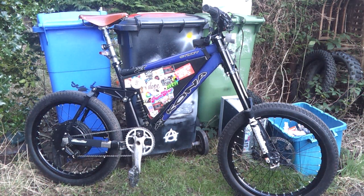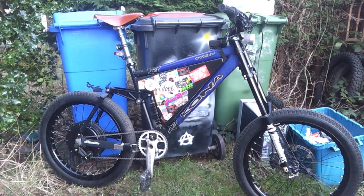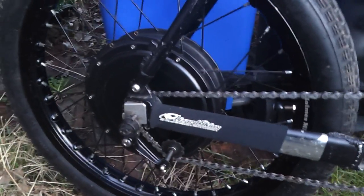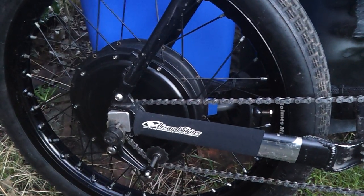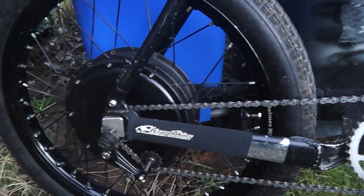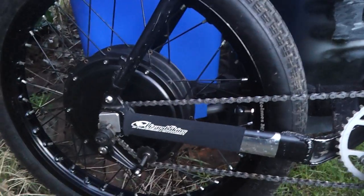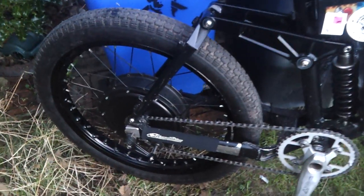So there's your hub motor in the back — it's just a chain tensioner on a single speed. I can pedal along with it, but I can't ride it without the hub motor though. It's not very pleasant because you have to get over all the magnets inside the hub — there's about 90 poles. Pedalling is a bit of a chore, it's a bit like riding an exercise bike. There's a lot of resistance from that back wheel. Should that motor stop working for any reason, riding it as a bike is extremely unpleasant.